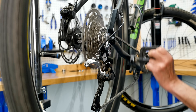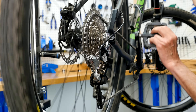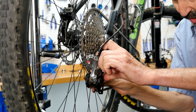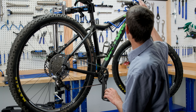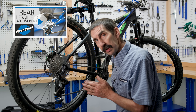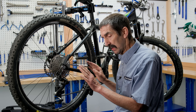We're going to shift up, up, up. We are not hearing those noises. This last one, I want to be extra careful. I made it — but remember that L screw? This is going to go right into the spokes. So it's time to put it back out. We need to get over to the adjusting video — how to adjust a rear derailleur. Set the limits, set the indexing, check the B. That will all be good on this bike.